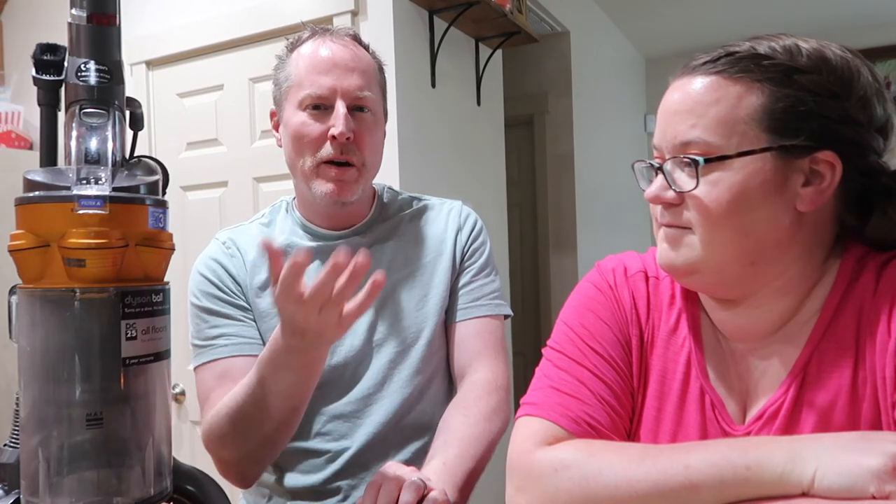I highly recommend you clean out your vacuums — maybe twice a year for the deep clean? I would do the hair once a month. Maybe the rest of it twice a year, though you're probably supposed to do it more. It depends on your environment — if you live in a dusty desert area, you may need to do it more often. Leave a comment below with the last time you cleaned your vacuum, and be honest. If you've never cleaned it, let me know. I'm curious how often people do it on a regular basis.